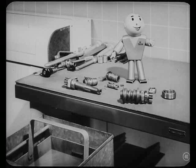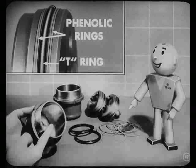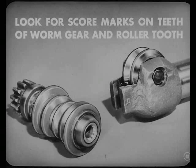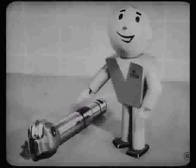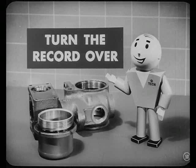Now you've got everything apart, so clean them up with solvent and inspect each part. Examine the pistons and cylinders carefully for score marks or scratches — if they are damaged, replace them. Always replace those phenolic rings and synthetic rubber T-rings when you have the pistons out. Look for score marks on the teeth of the worm gear and on the roller tooth. If there are any and they can't be smoothed out with crocus cloth, replace the parts. Take a close look at the roller shaft for signs of damage from the shaft bearings — if the shaft is scored, you'll have to replace the roller shaft and the needle bearings. And now, if someone will turn the record over, we'll put this unit back together.